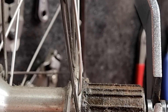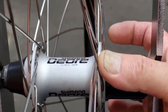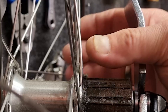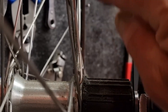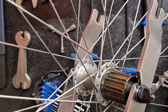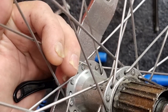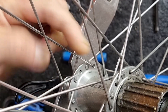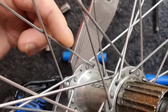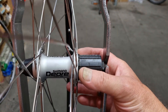That will stop it flexing so much, basically make the spoke last longer, give you a better tension on it, and the wheel will be much better to ride because it'll be a little bit stiffer and not so sloppy. I do this when the wheel's just been laced up. On the outboard spokes, I just push the spoke in like that — as you can see, it's made it go straighter to the rim so it won't flex so much. For the inboard spokes, you do it slightly differently: get your two fingers behind it and with your hand on the axle, just pull it out, and that makes this section run straighter from the hub to the rim.